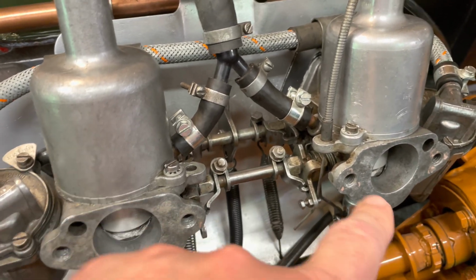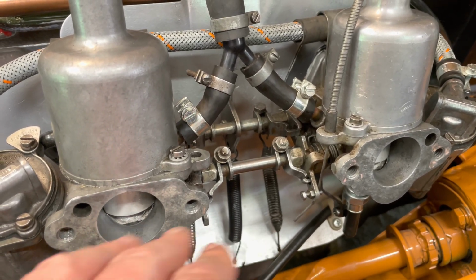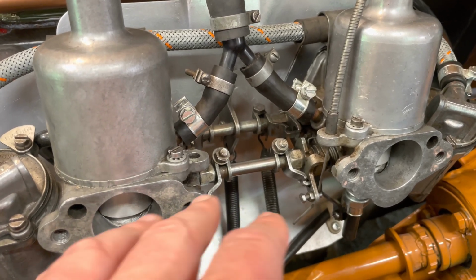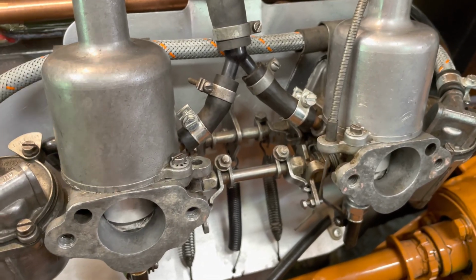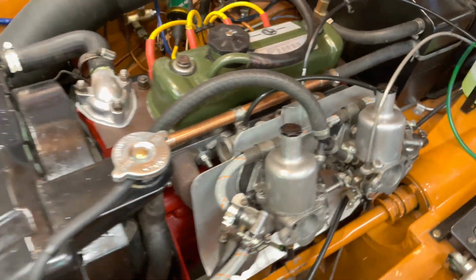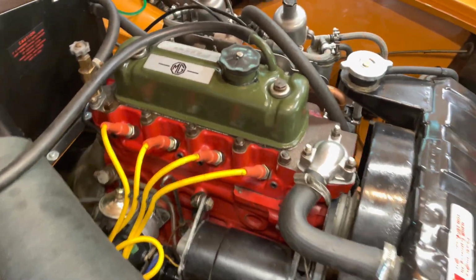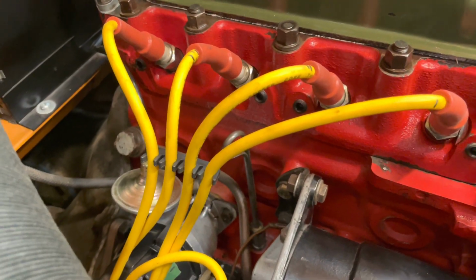I know I've got fuel in both carburetors because when I lift up the pistons, I can see that there's way more fuel sitting in there than there should be. And I think it's because I'm trying to make it suck more air as I give it throttle, and it's not burning any of it, so it's definitely running way too rich, but I don't think that that's the primary cause, because it was running fine before, and all of a sudden it just started to run like crap.